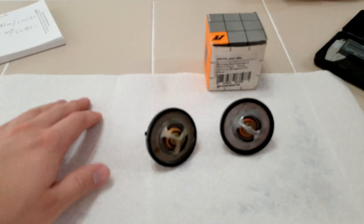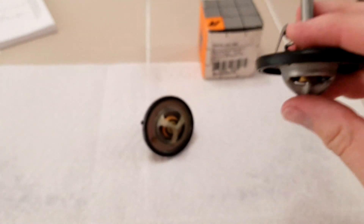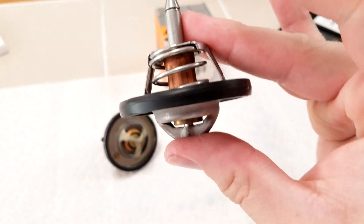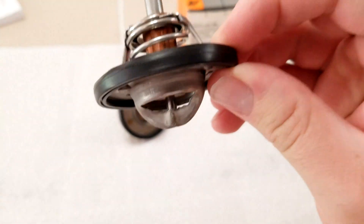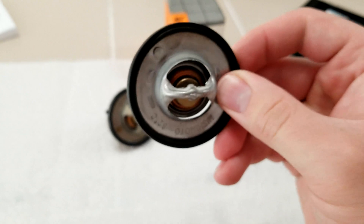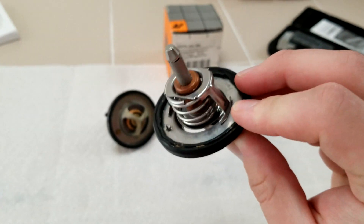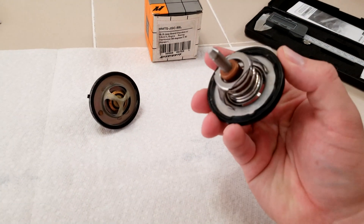Another issue I had: when I pulled this out of the Jeep, you can see that everything's lined up right now, but inside the thermostat there's a small pin in there that had actually come out, and the entire internal apparatus of the thermostat was sitting in a cattywampus state — like so. This is actually how it came out of the Jeep; it was not closed all the way. Which is kind of troubling — I paid this much for a thermostat and it didn't work properly. The nice thing is Mishimoto offers a lifetime warranty on these, which is surprising for a thermostat, but given the cost, it's probably well warranted.